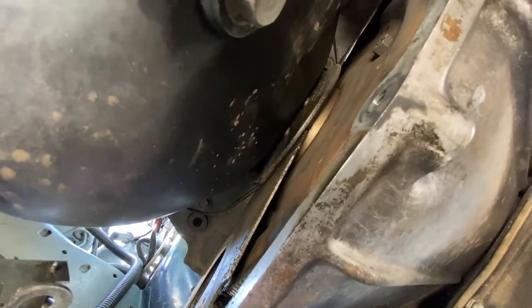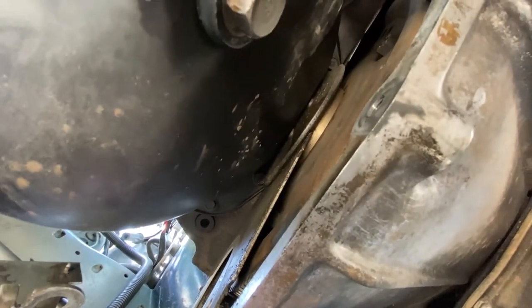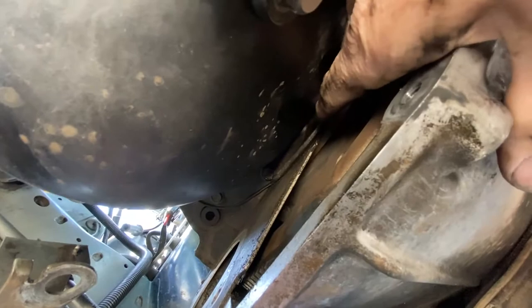Okay guys, so back here at the back of the engine, you have two bolts. Way up here, you got one on here and one over here. Those are half inch. This is a rubber, it's not even really a gasket. It's just to put pressure on the other inspection plate. So those are half. You do have to kind of push past it with the socket to engage the bolt. And so we'll go ahead and get started here.